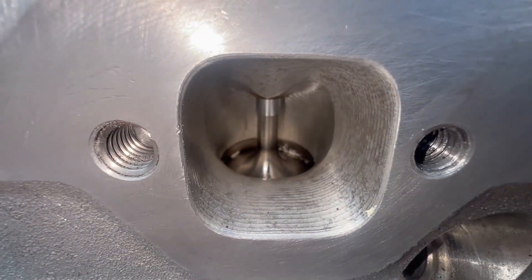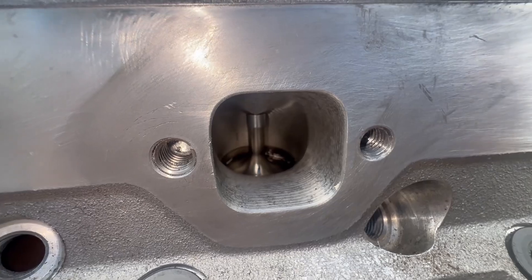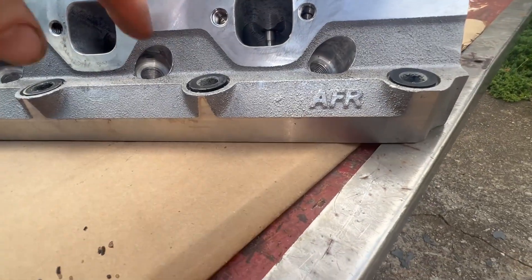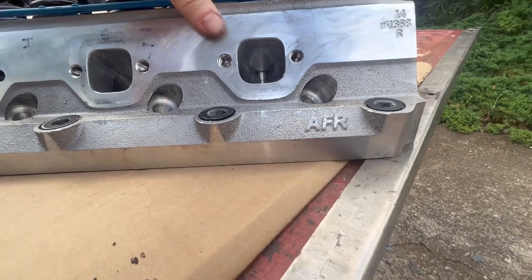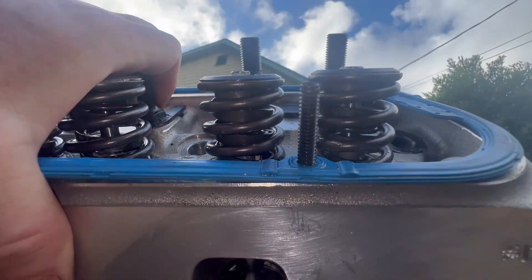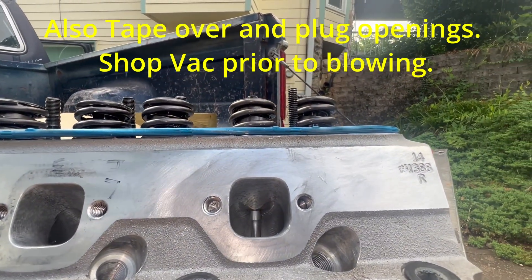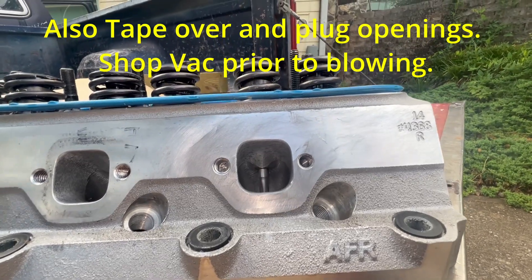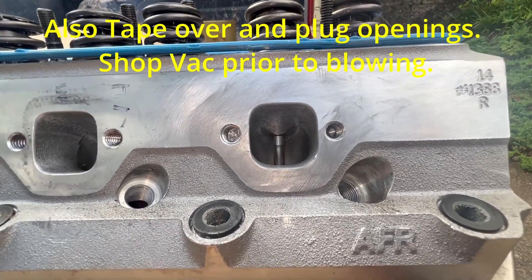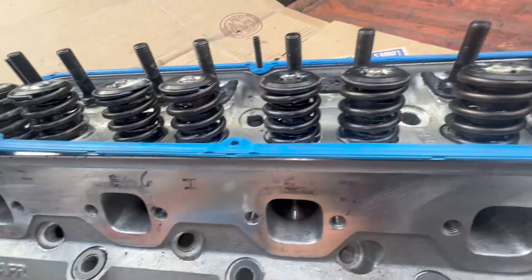Don't forget to blow it down and check, check, and recheck. You can see there's stuff down in there — I just did a quick poof on it and there's still a lot of stuff down in there. Whenever practical, I actually do things upside down because gravity makes stuff go down. On the engine block, anything I'm doing to the deck surface, I actually have it on the stand upside down so everything just falls out and down, not into the cylinder. Just don't forget to give everything a good blowout with some high-pressure air.